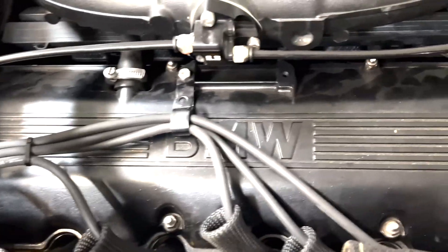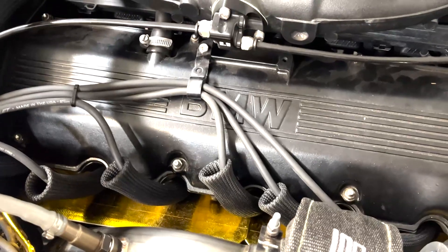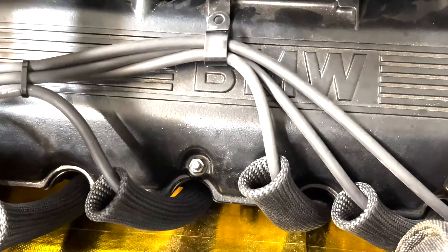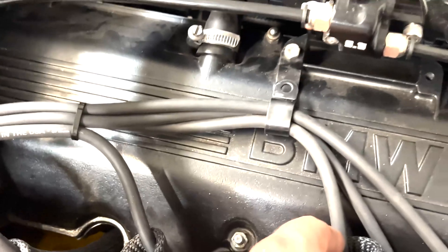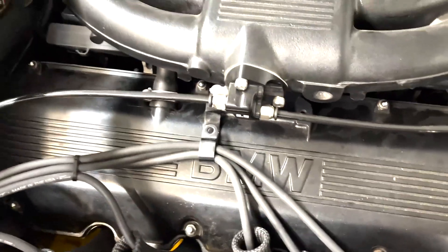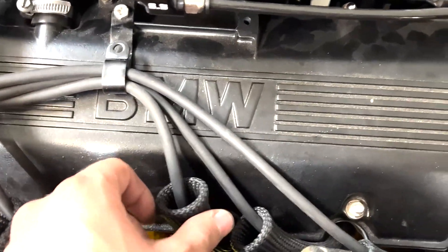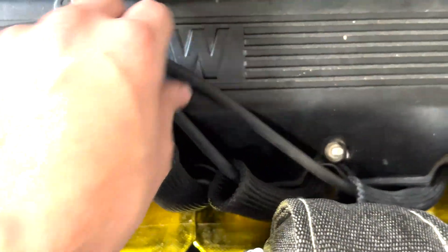Engine bay — it isn't pretty much done, it is done. Last night I was just getting some stuff done, little things here and there. Messed with my plug wires, got all those set up. This is an ICT billet LS swap kit, so they come with long wires with the right ends. I made a little bracket to hold cylinders one, two, and three up so they aren't close to the turbo. Might need to tighten one up a little bit, but it's okay.